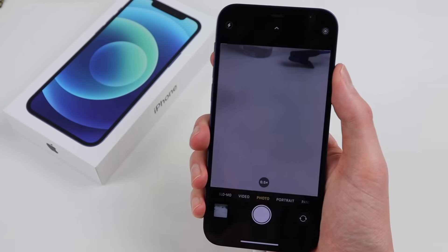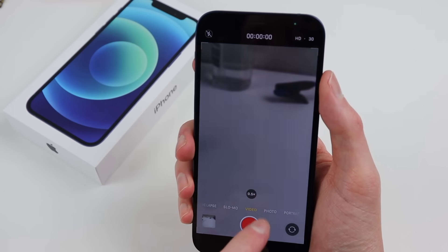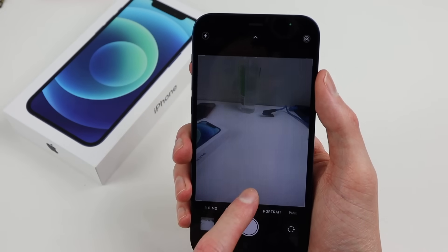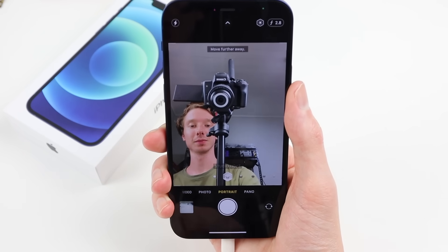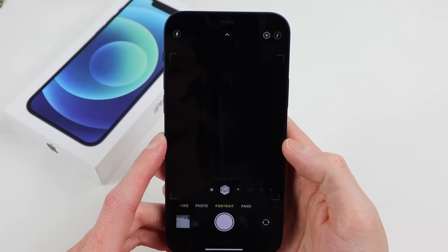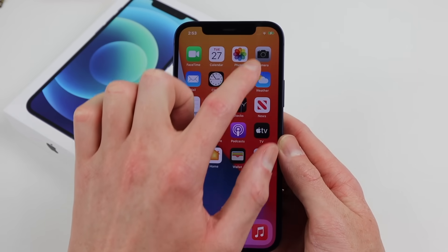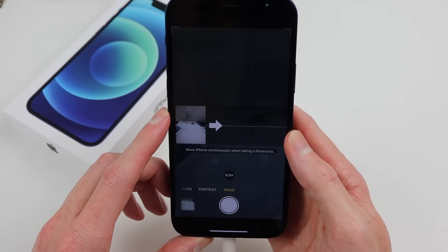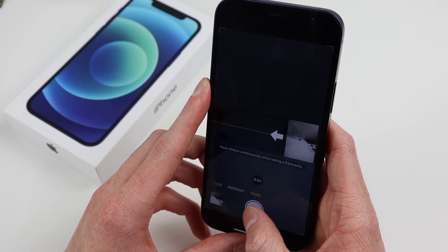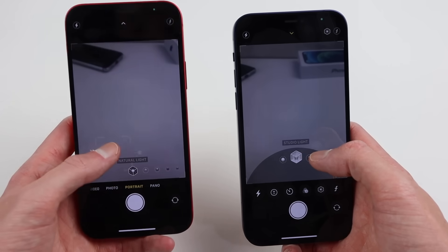What changes now is the camera has been affected — it's completely unstable and broken, with the camera freezing in photo mode when switched to the 0.5x zoom. In video mode, both cameras and zoom work fine. After returning to photo mode from video, the 0.5x zoom now functions. However, after changing the camera, two functions are now completely unusable. Portrait mode only works for the front camera, with the back one only flashing still images and a black screen. The camera app tends to lock up. Relaunching it, you can see panoramas also don't work when using the 0.5x zoom — you can see the camera is working fine in the small viewfinder, but it's blocked and won't let you take a panorama. I tested this with both phones and they have the exact same symptoms when the rear camera has been swapped.